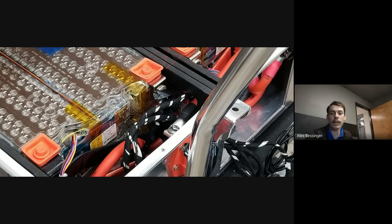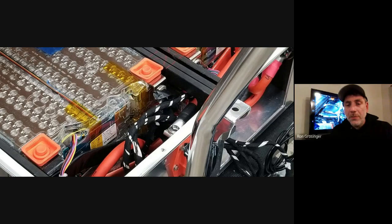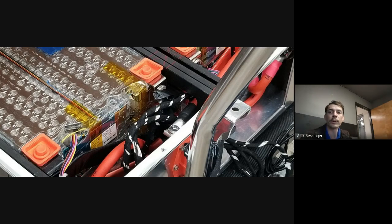No, a lot of the time it's cell failures. I don't think I've ever seen a module where the fusible links have blown. I'm sure there are situations where people have seen it before, but I think that's pretty rare. Usually it's a cell where the chemistry has gone to a point where either it's really low capacity or it's a parasite. It's become basically a resistor that's pulling power out of the cells around it.